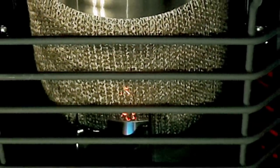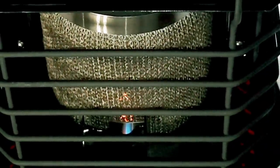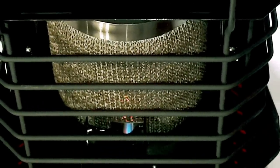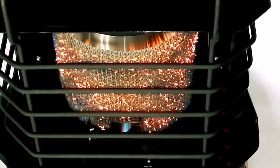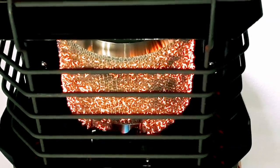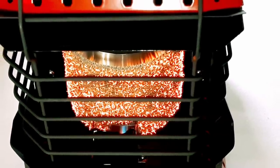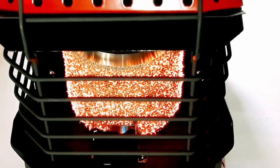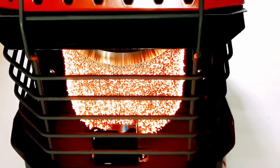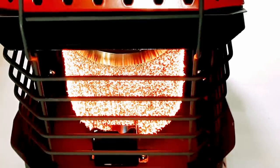The pilot is still lit. Now all you have to do is press down on the knob just a little bit and you'll be able to light up the entire element. Right now I'm putting it on low — you can see it lighting up on low. A little higher than low, then medium — I can feel the heat coming off and it is very nice. And here we have it on high, so right here we're drawing 11,000 BTU.